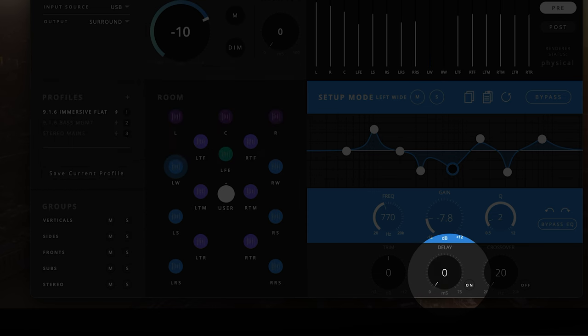Keep in mind that if a speaker signal is late and the rest of the speakers are aligned, the correction would have to be applied to all of the speakers except the late one to compensate. For example, if the left height speaker was 0.5 milliseconds behind and all the other speakers were at 0 milliseconds, it would be necessary to add a 0.5 millisecond delay to all the speakers in your setup except that left height one. In most real-world cases, there may be more than one speaker where there is a need for a delay adjustment, so make sure to perform the required calculations to get them all in line.